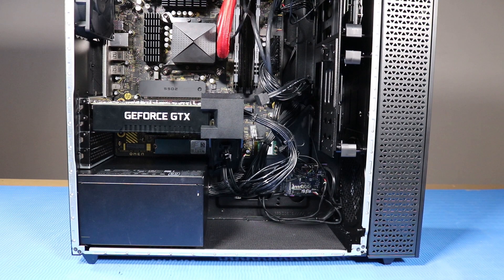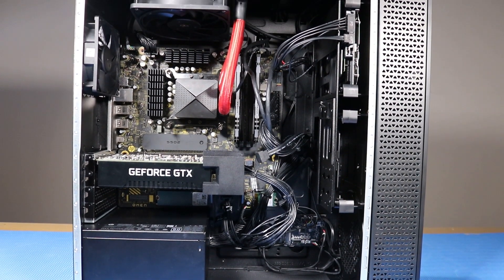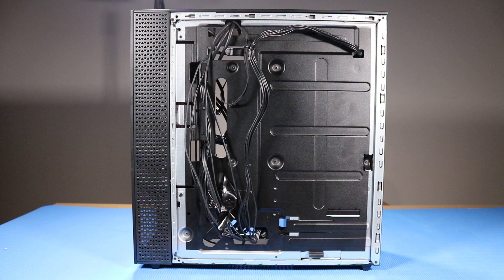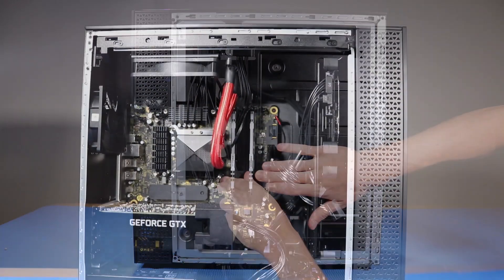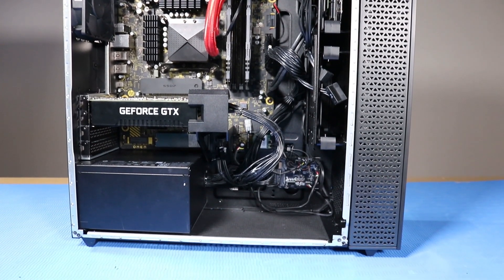As you complete the replacement of a part for the desktop, you should ensure that all of the cables are correctly routed. The interior of the system should never look like this after a service event. As you route any cables that you've connected back into position, be sure to use the clips, hooks, and tape that are provided on the chassis for this purpose. This prevents the possibility of cables snagging or sagging when the desktop is moved.